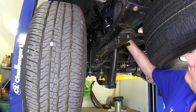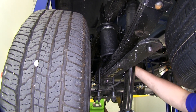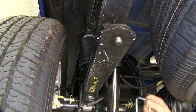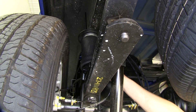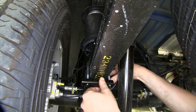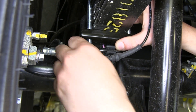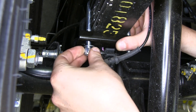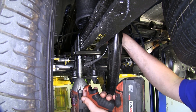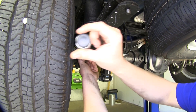We'll now take our airbag and put it on top of our leaf spring. We'll need to go on the outside of the frame with the upper bracket and on top of the leaf spring with the lower. There's a small flange here in the front — you want to make sure that sits on top of your factory U-bolt on the rear side behind the axle. Then take the U-bolt provided in the kit, slide it over the top of the lower bracket through the small slits on each side until it drops down over your leaf spring. Place the lower part of the clamp on the bottom of the U-bolt, followed by a flat washer and a lock nut. Do the same on the other side of the U-bolt, then tighten them down evenly working back and forth using a 9/16ths socket, and torque them to the specifications outlined in your instructions.